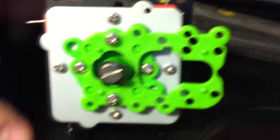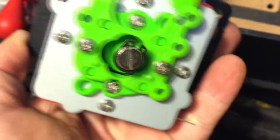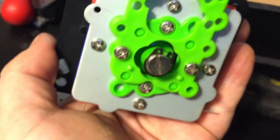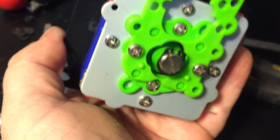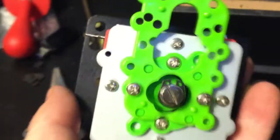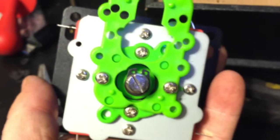I've changed it to four-way now. Basically it prevents you from clicking two directions at once - you can go up, down, left, or right, but you can't really hit the corners because the restrictor plate prevents it. That's what makes it a four-way. Similarly, if you put it on that other position, it would be two-way, which would be good for games like Galaga.